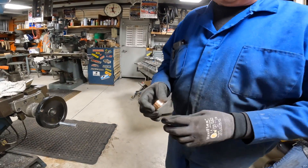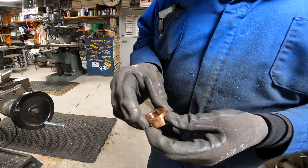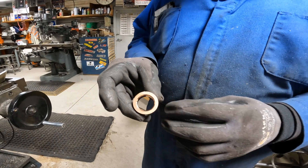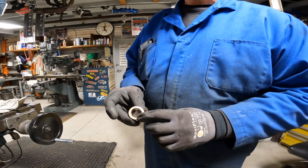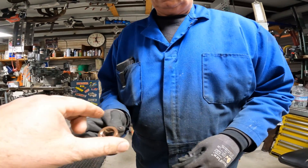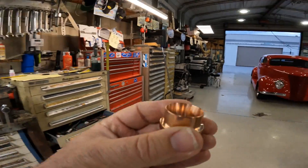Here's the seat. The back side is made into a venturi, and this side will get an under-seat radius and then the top angles. You can see there's the venturi right here.